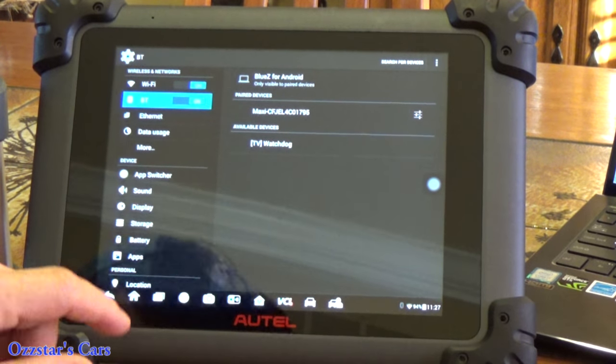Let's go to Setting — tap the arrow down. That tells you what we currently have programmed. If you want to change it, tap the white screen, get your keyboard, and change the numbers. We've got to make sure we have the right brand of battery and enter the new serial number. That's how we'll update the coding. So after we swap the battery, we'll escape out of this, swap the battery, and input that new serial number — that's our new code.